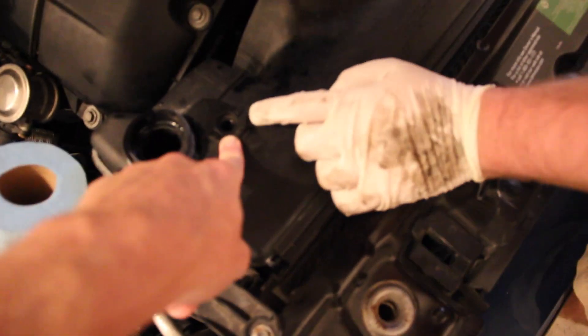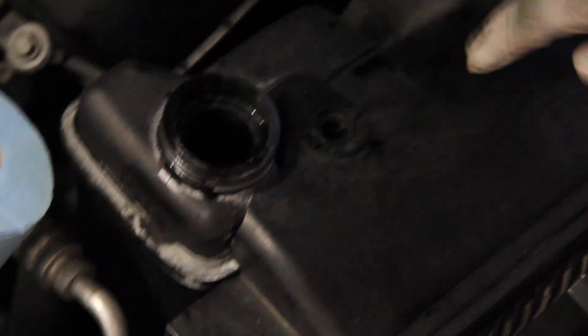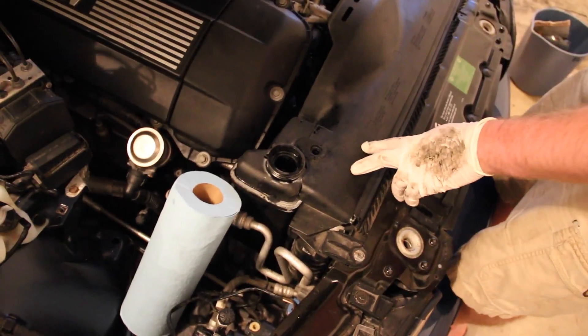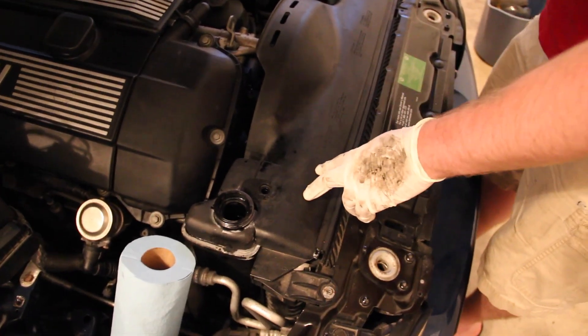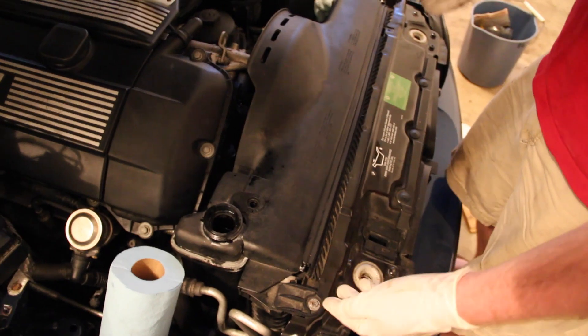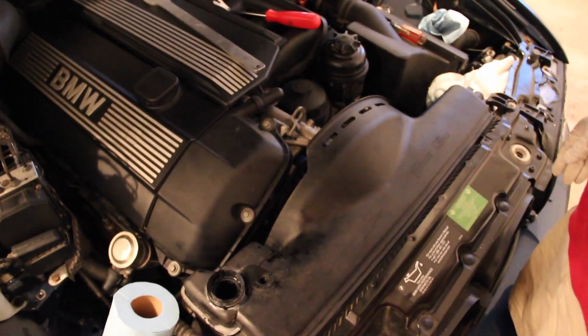We unscrewed the bleeder screw right here. The next thing you need to do is remove the clip on the expansion tank — once you do that, the expansion tank is going to rotate back. There are two little pinions that stick down into the fan shroud. There's a hose attached to the bottom and one attached to the top that runs across the front of the radiator. That top hose has a one-use pressure-fit clamp, so I recommend replacing it with one-inch standard screw-down hose clamps. E39s are known for cooling issues, so you'll probably need to take it off again — much easier down the line.